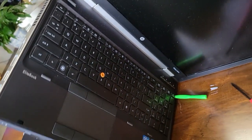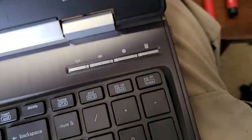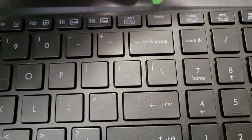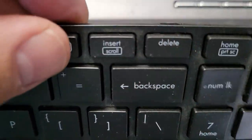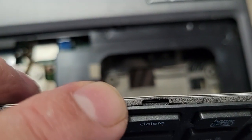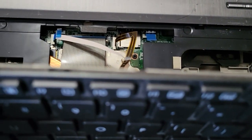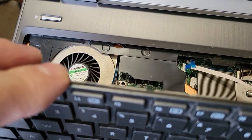What you're trying to do when you get your keyboard out: it's snapped in on the top here, so once you get one of those released you'll see right here — that's what's snapped into those all along there, so you'll have to snap each one out of there.